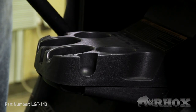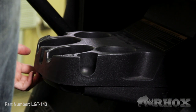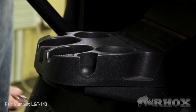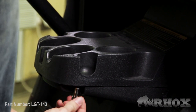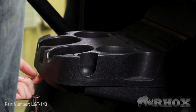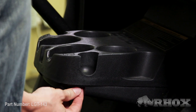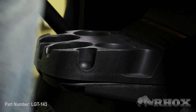Now that our cart is disconnected from the battery or battery pack, our first step is to remove our cup holders. On the underside of your cup holder, there are going to be three nuts — one on this side, one right in the middle, and then another one on the other side. If they're not too tight, you could probably do it with just your socket and your hand. Go ahead and twist those off. If you have trouble, you can pull up on the cup holder to put a little pressure on the nut. Once your three nuts are removed, you can lift up on the front of the cup holder and pull forward.